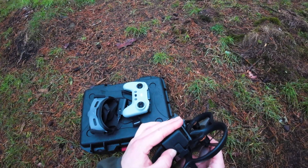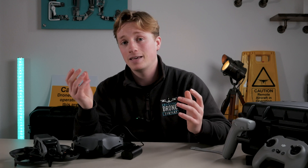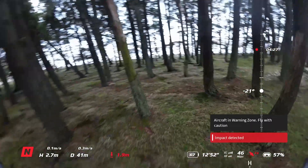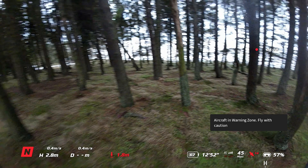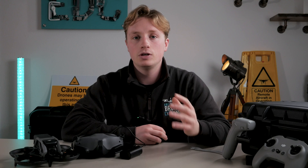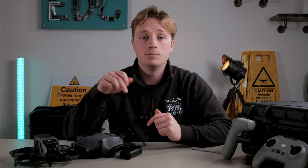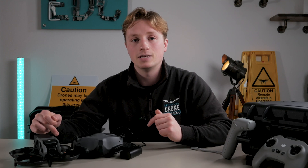The battery slides in at the back and plugs in at the bottom — press and hold to start the drone. One major problem with the battery system is that batteries can fly out of the back and power off the drone even in minor collisions. So always keep your drone close and make sure your spotter can see it. This appears to be a universal problem, and the batteries also take quite a while to charge.